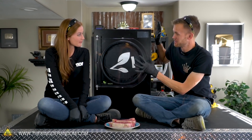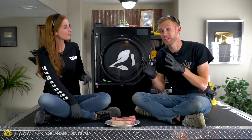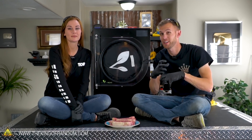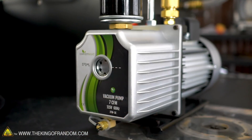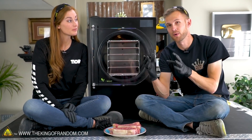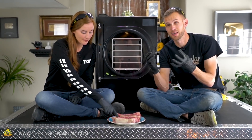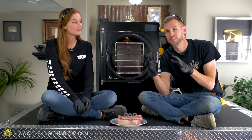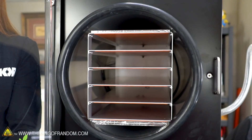The general idea is that this machine — first you put the food in and it gets cold, really cold: 50 to 70 degrees below zero Fahrenheit. After it gets down to that temperature, it starts pulling a vacuum. Everything in the trays gets pulled into that vacuum, and once all the air is pulled out, it starts warming back up. At that point, under super low pressure, all of the water in the food — which is frozen because it's super cold — starts to sublimate. It goes directly from ice into water vapor without going through a liquid stage, kind of like what dry ice does, but water only does that under such low pressure.